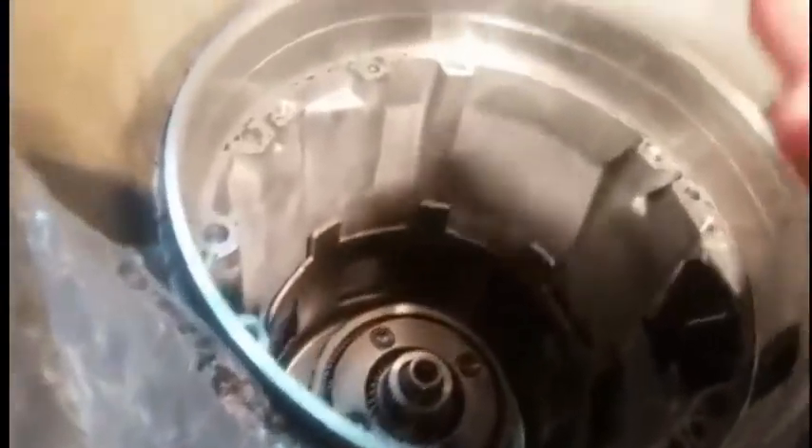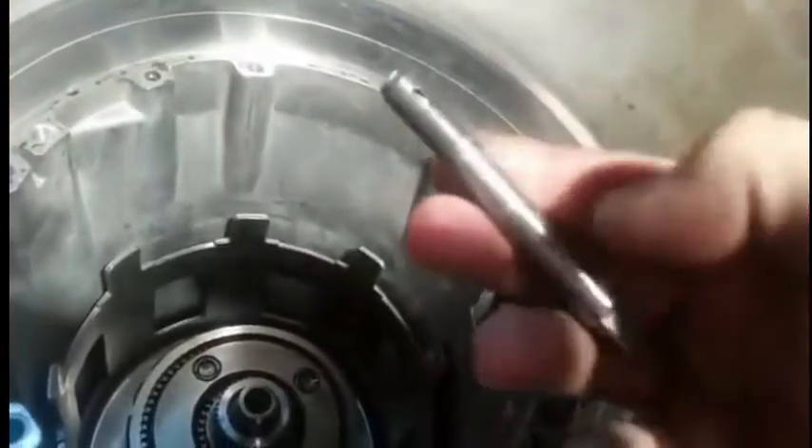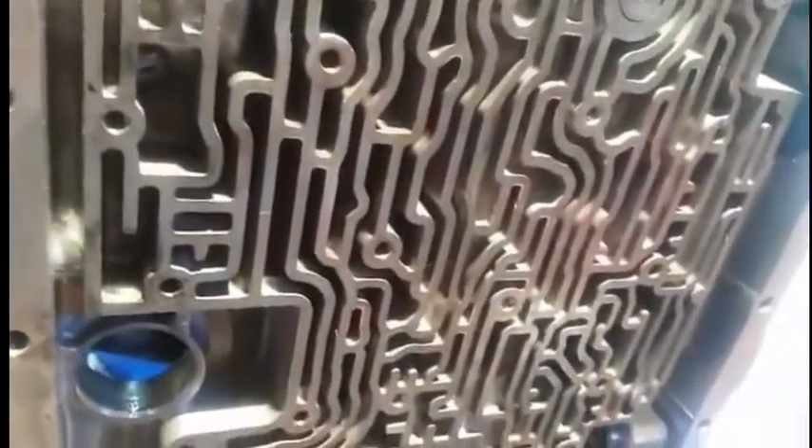So the right solution that I use is a brand new check ball capsule. This is the AC Delco, but you can get it from your transmission shop. They're like $10, and you just have to pull out your old one and push this new one in. I used a screw extractor — I can't remember what size — but I had to grind the shank down on the bench grinder so that it's a uniform size all the way back, so it will actually fit up in there and grab it. Then you just tap it in lightly with a hammer and put your vice grips on the back and pull it out. They're in there pretty snug, and you have to set them in pretty snug too, because they're a press fit. That's where it goes, and you can see the hole in there. And it actually exhausts into the case out of this hole right here — the bigger hole of the two on the side.